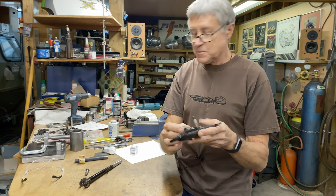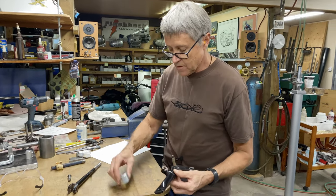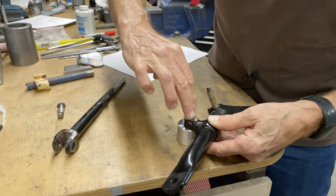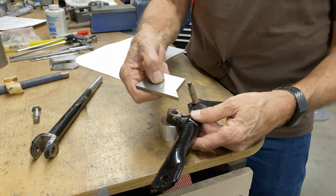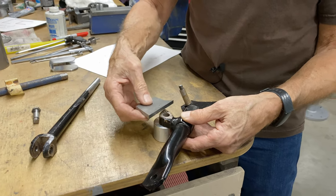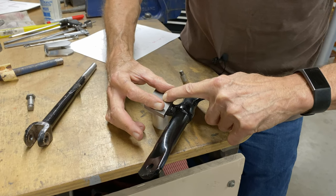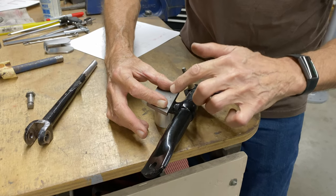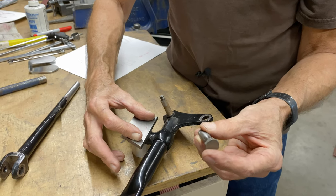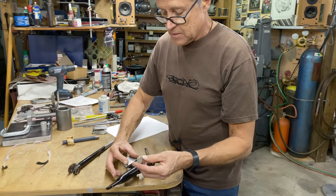I had to think about this. I have a piece of aluminum going onto the mill table, and the side stand sits on top. I'll drill a 7/16 hole, line this up, and then put a clamp on either side onto the table — that's what's going to hold it. Then I'm going to bore right through and make the hole almost 5/8 — 5/8 is 0.625, so we're going for something around 0.600. I checked my boring bar and it will go down small enough.